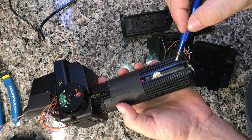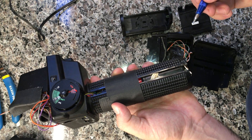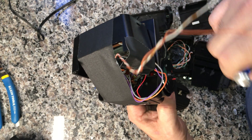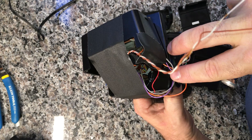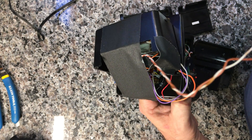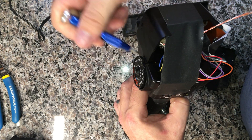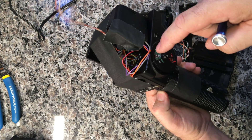The capacitor which is inside is pretty well glued in, so don't expect that to come out. The back half should separate once you've got those two screws plus the screws that are exposed when you rotate the head up 90 degrees. There's a pair there, under there, and under there. Those are attached to a metal frame on a PCB inside.